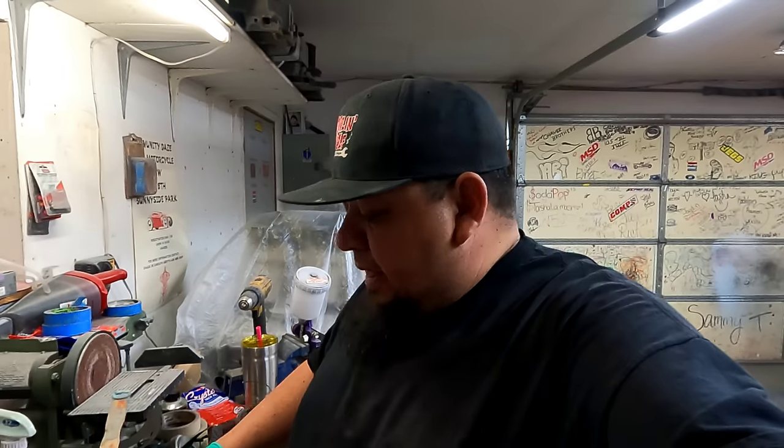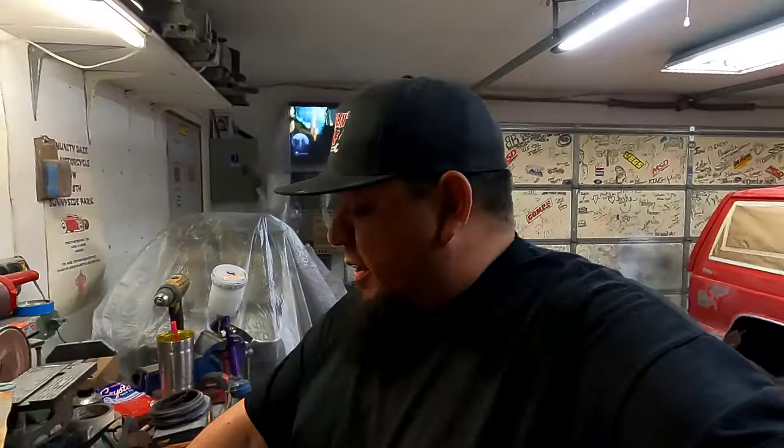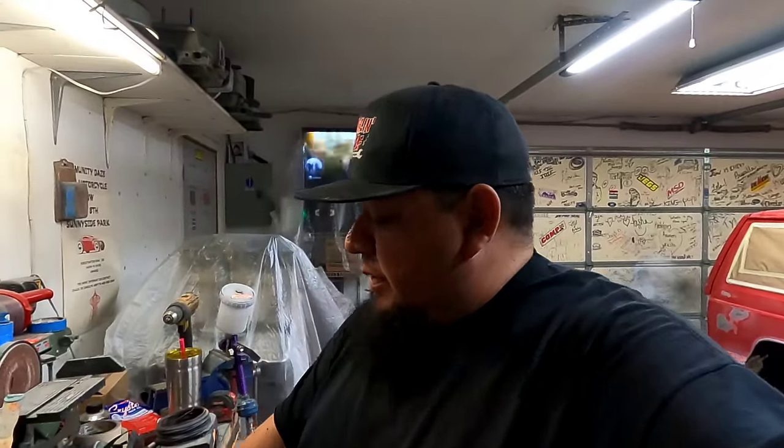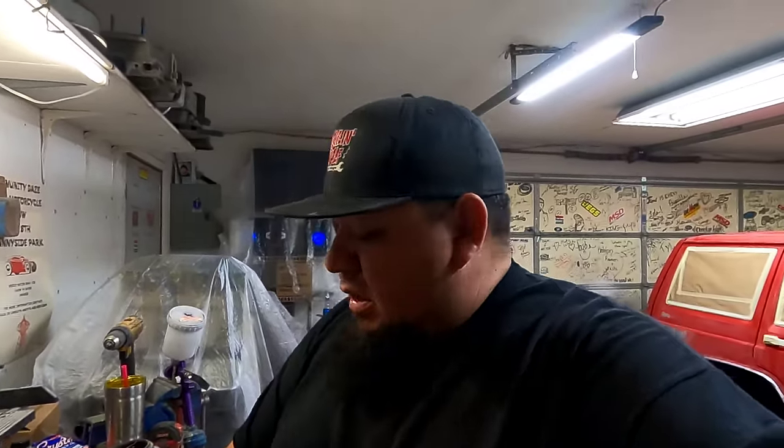So don't get in a real big hurry right away. Just spray it on there. Make sure you got enough on there. You want to get it as close to running without it running, if that makes any sense. That's the best paint job you can do, one that is super wet and just on the verge of running, not waterfalling or nothing. You still want it nice and tight, but you don't want any ripples in it. And that helps get rid of orange peel and all that stuff if you can get it really, really wet.